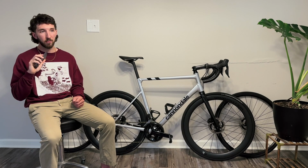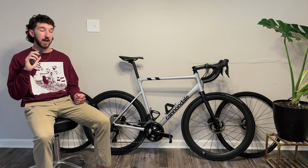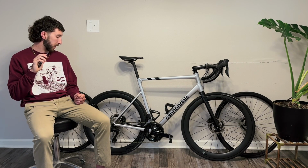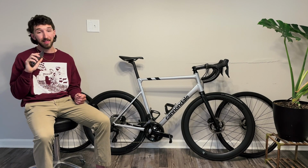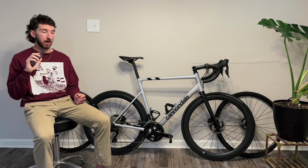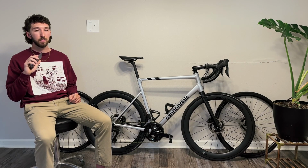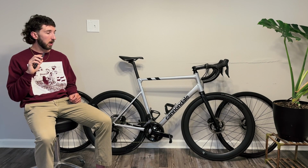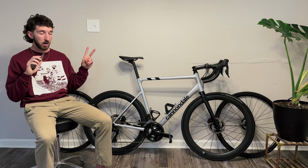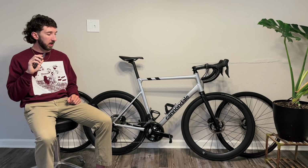Then I have moved from the Shimano 105 11 to 34 12-speed cassette to an Ultegra 12-speed 11 to 30 cassette. It's lighter, and since I live in DFW, it's pretty flat, so I don't necessarily need the 1-to-1 climbing ratio that this bike initially came with. So to review, these wheels are more aerodynamic, lighter, and have wider tires, so more comfortable than the stock wheels that came on this bike and that I've been running for a while.